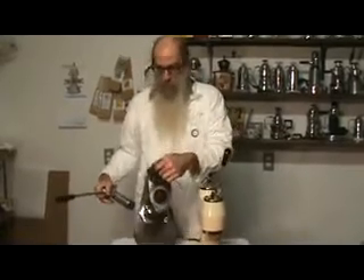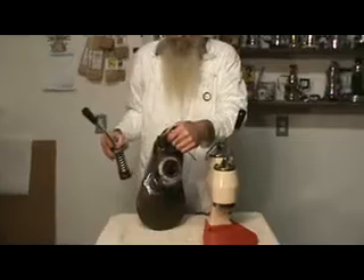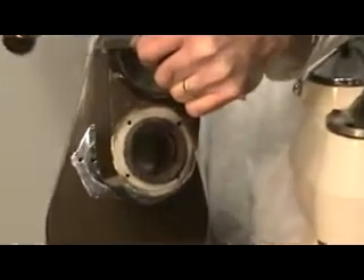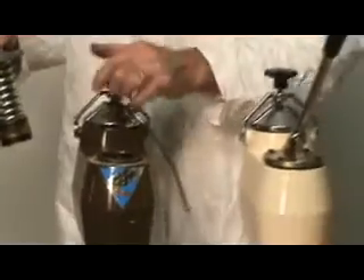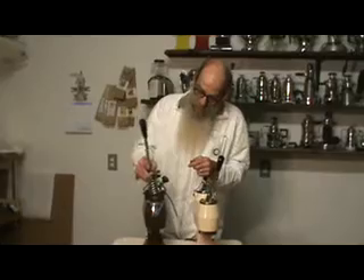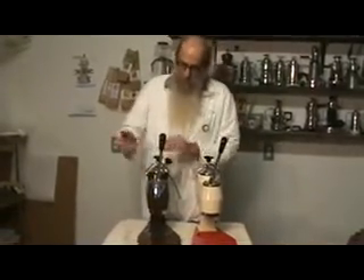You see in here — that's just a complete brass cylinder that runs through the entire group all the way down to the dispersion screen. You still pretty much have to take the boiler off the base to maintain the group itself. But for your routine maintenance, put a cloth down in there, wipe it out, re-lube, re-lube these, and then they go right back in just like that.